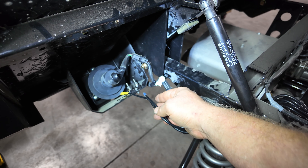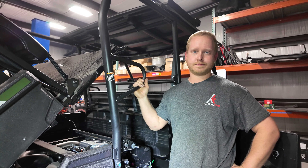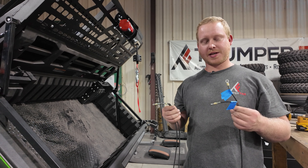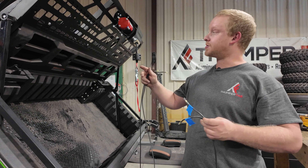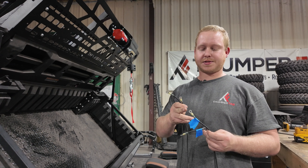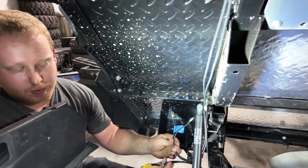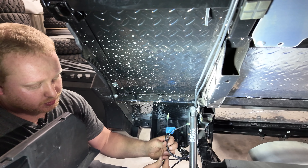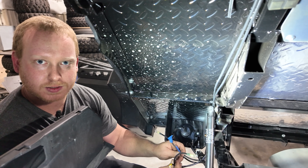Before connecting at the junction box, we'll run the wires down from the winch on the headache rack so we can connect all four wires at the same time. Here we have our extension wires that we'll use to route from the headache rack down to our junction box. They're the same length and the same color, so we put some blue painter's tape on both sides of one of the wires to help us keep track of the blue terminal from the winch to the junction box. You'll use a 10-millimeter socket to fasten the wires to your winch. Then, with our wires ran from our winch contactor box and down from our winch, connect them to the bus bar, matching the blue terminals together and the yellow terminals on the same terminal of the junction box.